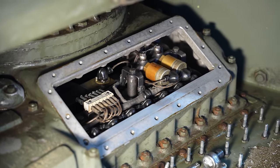Yep. Then we refill the cooling system, which I think is about 100 litres of fluid needs to go in. And I've made up a sort of a test rig so that we can put some pressure on the cooling system to do a leak test. We only want to put it in once. That's right. That's it. Easy, because there's some pipes on the bottom so that when it pivots it doesn't hit the pipes.